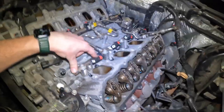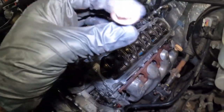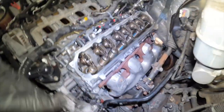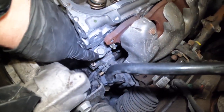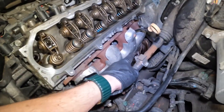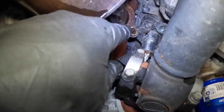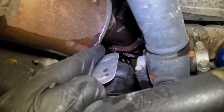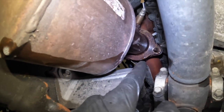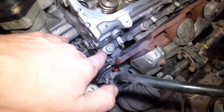After removing the intake, next is the exhaust. I removed five bolts — 13 millimeters — from the exhaust. I need more space to remove the engine head bolts, so I'm going to lift up the engine and unscrew the bolts from the catalytic converter. I removed one nut and there's one more, then another one on top — basically three nuts on the catalytic converter connected to the exhaust. With the exhaust removed, that's enough for this bolt to come out.